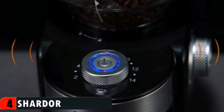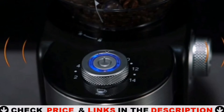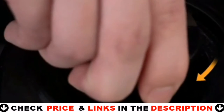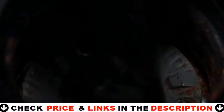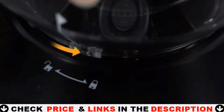The grinding process suddenly stops working and it sounds buzzing. This phenomenon occurs because coffee bean debris is stuck in the grinder. First of all, turn clockwise to remove the bean hopper and the upper burr. Furthermore, clean up the burr grinding disc. After cleaning, reinstall the bean hopper and the upper burr, and you're ready to go.